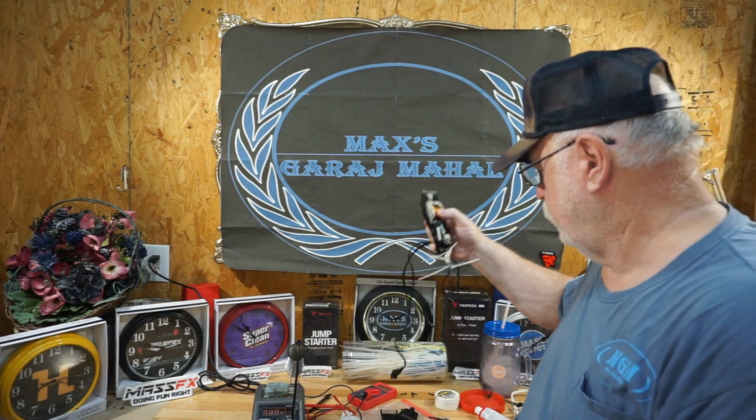So on most of your electric machines around the house, whether it be a heater or a toaster, microwave, or whatever, if it's getting loose connections, if you can solder it up, 99% of the time that's going to solve or resolve your problem. And if you see the problem is about to exist, go ahead and eliminate that problem, pre-eliminate that problem by going ahead and soldering it up. I don't like to use tape if I can help it.